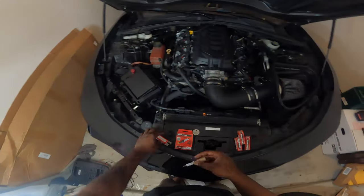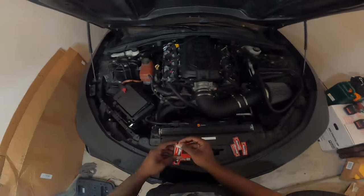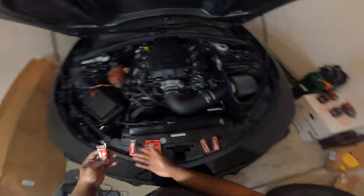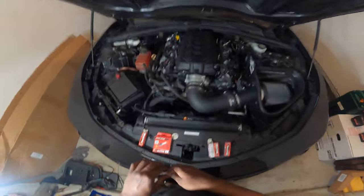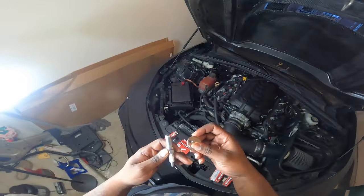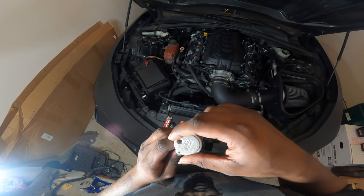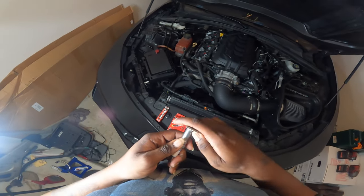Unfortunately I had to turn the car on and move it, so the car is too hot to take the spark plugs out now. I'm just gonna put them back in their packages and leave the top open so I know I've already gapped those, and I'm gonna do the same thing for the remaining seven. This is gonna be a little tedious but you definitely want to make sure the gapping is right on all your plugs — again, this one is just shy of what we want.